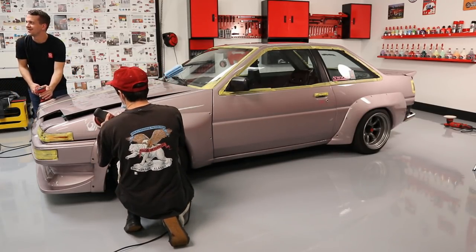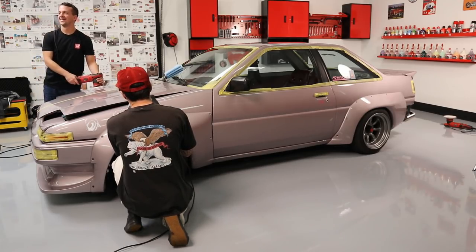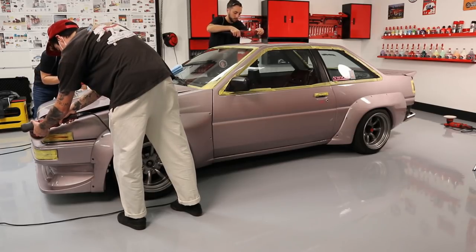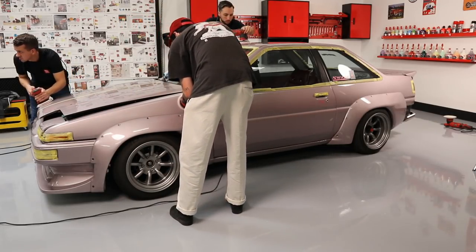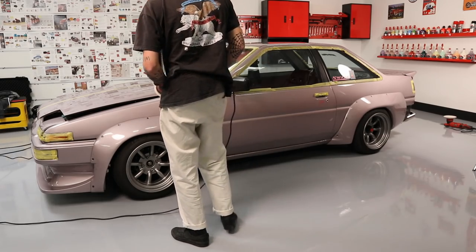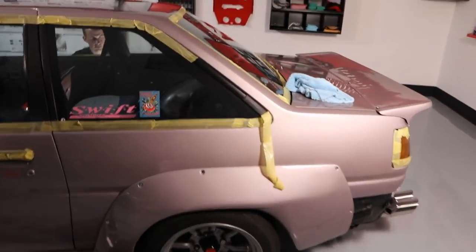I bump up to speed five and take it nice, steady, and slow with slightly overlapping passes. Using the plush edgeless towels to wipe off the product. We grab an LED light to assess the surface — not too bad up there, but this should knock out some of those deeper defects. It's tough to see on camera because of the metallic and lighter color. Metallics are great because once you get them right they're easier to keep looking right versus a plain black car where the first wash can bring swirl marks back. We did half of the car, and you can clearly tell the difference where we haven't done it yet.